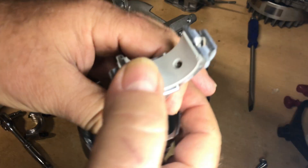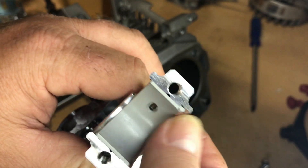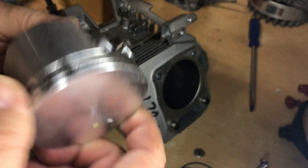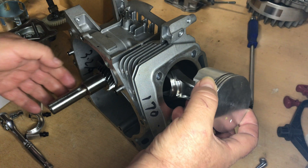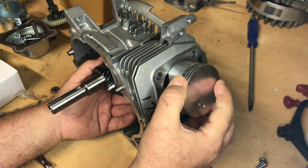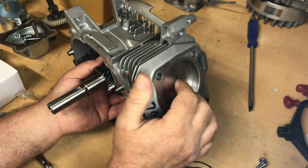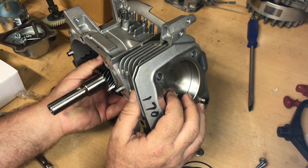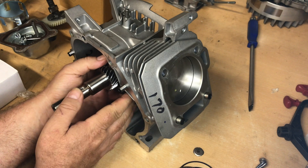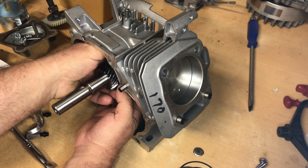I'm going to get this bearing centered here. If you don't push that tab all the way over, that oil hole won't be centered. Arrow down. Get the rod installed on there temporarily — got a good fit on that bore. Situated on the crankshaft here.